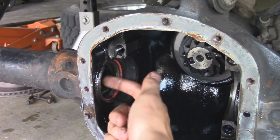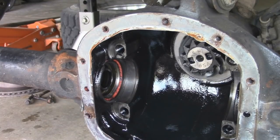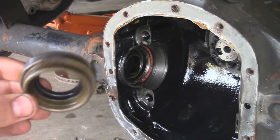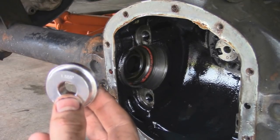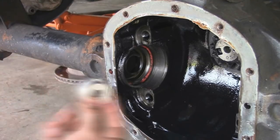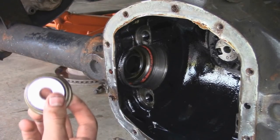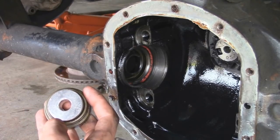Now you can see right here is actually the inner axle seal. They're going to be on both sides. In order to get this out it's going to have to be pounded out. To do that, you can either stick a long piece of steel through the axle tube and try to hit it out. My technique is to take a piece from a seal driver kit — about one and a half inches, the smallest one I have — and fish it through the axle tube so it's sitting flush against the seal. Then I take a broomstick and stick it through the axle tube and hammer on the broomstick to pound out the axle seal. It's probably not the proper way to do it, but I'm doing it with what I've got.